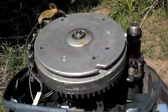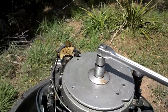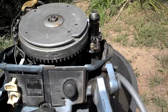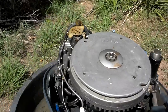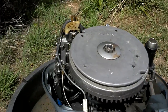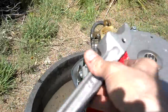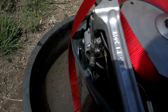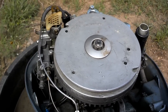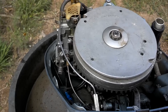To get to the points you have to take off the flywheel. It comes off with a wrench, but when you try to turn the flywheel the nut turns everything. You should not brace the propeller to provide resistance — you need to use a strap wrench. The strap wrench goes around the flywheel and provides leverage against the flywheel nut wrench, so you push in opposite directions and remove the flywheel nut.